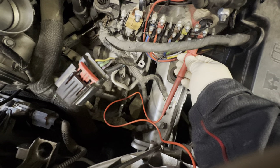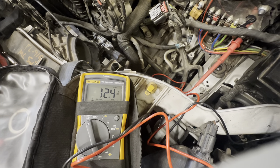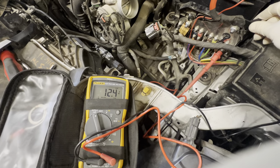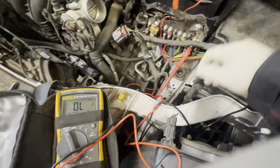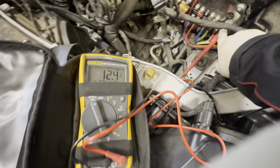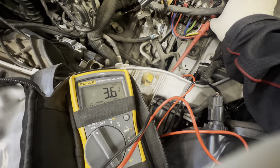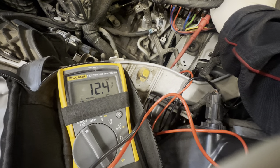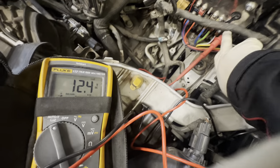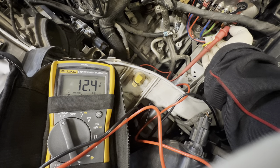Put it on this guy right here. 12.4... 3.6 — out of limits. 12.4, I'm pushing back on it, pull forward — 3.6, out of limits. That's totally it. Now I've put my finger on it, I'm just going to push it. Obviously it's having issues — out of limits there. This fuse is your problem, with that wire. It's really strange.